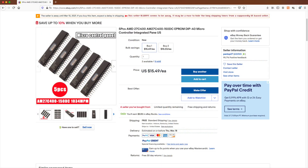Next up was buying chips. Not all chips are compatible with all logic boards or even all revisions of those boards, so do your homework and be careful. I was able to find some chips on eBay from overseas — they did take a while to arrive. I followed advice to purchase multiple chips since not all of them would likely work. If you buy a handful, at least one or two should work out. I finally got these chips in the mail — let's hope they're what we need to fix Logan's Macintosh Classic.